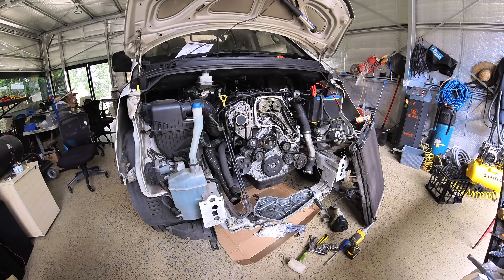This one is spring loaded and doesn't click into place, so I had a good look at it — there is flow of oil through it. Although the sound does sound like it's coming from here, I'm still leaning towards the other option which was my first choice: the oil pump. The oil pump is possibly not putting out enough pressure, not lubricating quick enough. Although the sound is coming from up top, if it's not getting enough oil that could definitely be the problem. The other option is it could be in the head, but I'm leaning away from that because that's going to be a massive job. So for now I'm going to go for the oil pump, check the relief valve on that, and hopefully that will fix it.